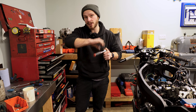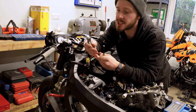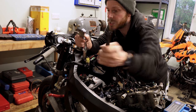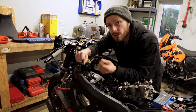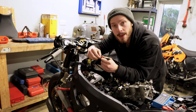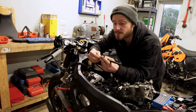I'll remove the plugs, turn it over to top dead centre on cylinder number one, and check the clearances on that cylinder. Then turn it over 180 degrees on the crank and check the next cylinder, continuing until we've got all the clearances. Use your feeler gauges to check the gap — I've got loads of different sets, some with 45-degree angles to get around bends, some nice and short, and the longer generic ones everyone has. The two main things people do wrong to get a misreading: forcing a big shim in and creasing or bending the shim itself — once there's a lump in the shim you'll get a misreading. So always check your shims are nice and straight with no kink or bend.